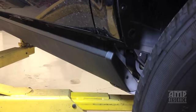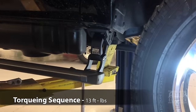All right, we're ready to do our torquing sequence. At this point, the 2 bolts on the passenger side, if you read your instructions, the first 2 you tighten are these 2 here, 10 foot-pounds of torque. This will be your second bolt you'll tighten, right here at the adapter. All right, so we'll tighten these. Second bolt we've torqued, we'll torque to 13 foot-pounds. And then we're going to go to the body mount bolt, and that'll torque at 44 foot-pounds. That's the third bolt you tighten. Has to be tightened in this sequence.